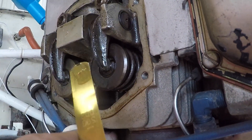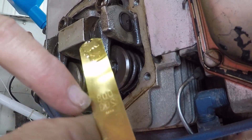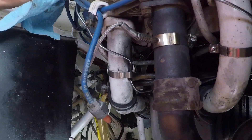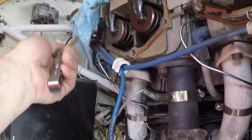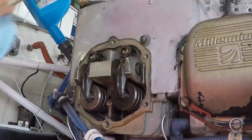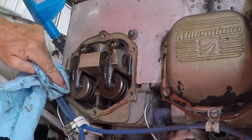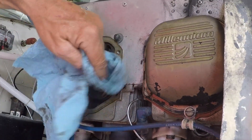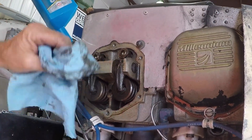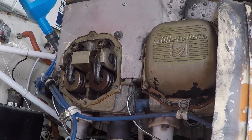This valve and this valve have now been set to 0.008. Let's see if we can read that on the feeler gauge — it's a brass feeler gauge, kind of hard to read, but it says 0.0078 to 0.009, and the closest we have is 0.008. We hope you found that useful and informative. It's not a fun job, but it's one of those things on your annual checklist that takes a while to perform. Thanks for watching.